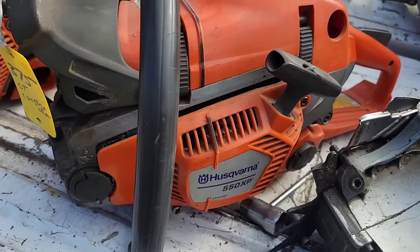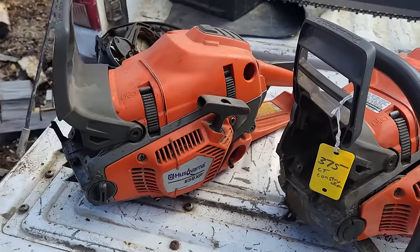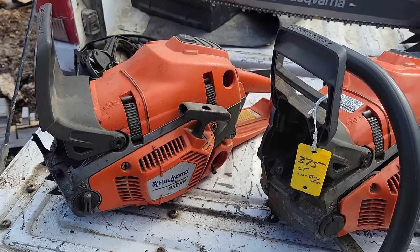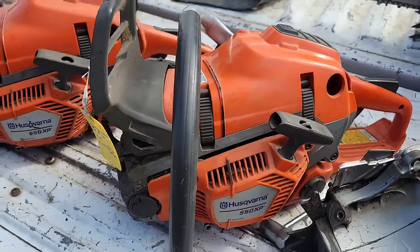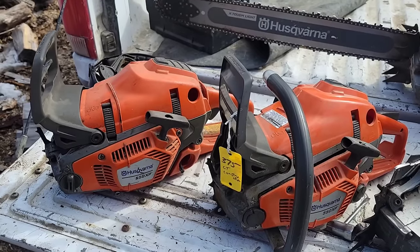And I think these are hot. These are very nasty little 50cc saws. In fact, they'd probably cut along with a ported saw, a modern, you know, or an old 50cc ported saw. Which means they make heat, you know. More horsepower means more heat. More heat means a leaner saw. A leaner saw means if you have a dull chain, it's going to blow up.